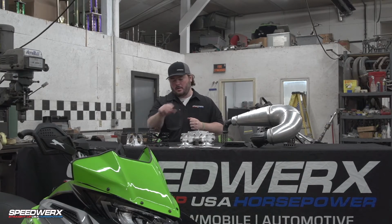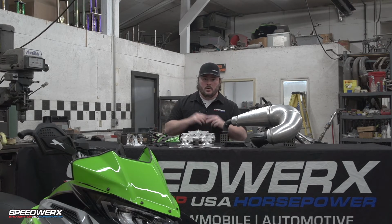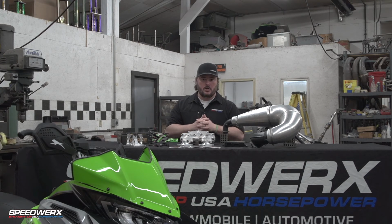So again, head, clutching, reeds, ECU. That completes our Stage 1 package. 6.5 horsepower gain over stock, premium 91 octane fuel, and hang on, because she goes like stink.